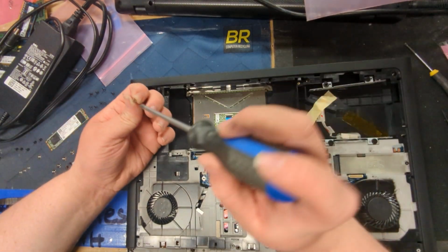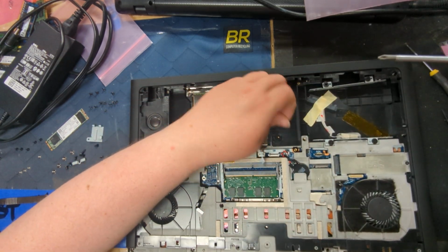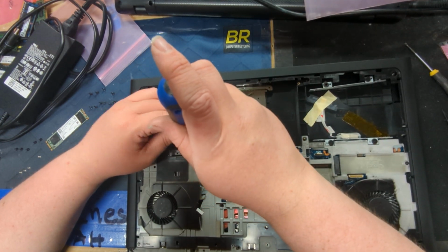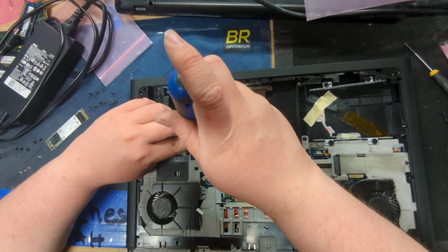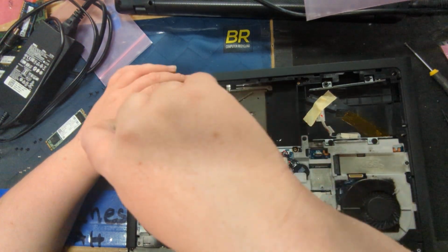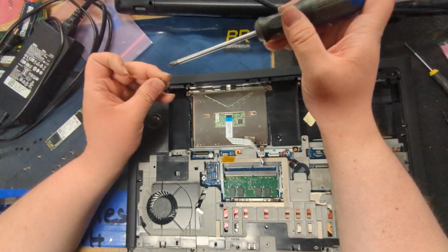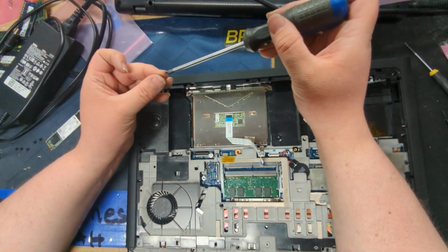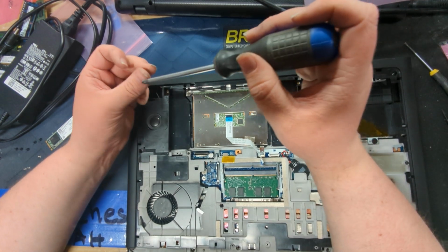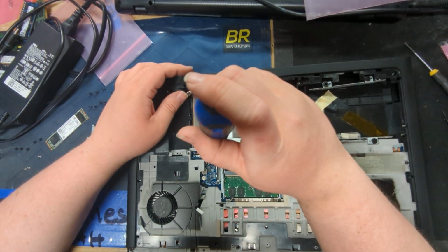Okay, so we want to remember that we have these flat screws that go here. Having a magnetic screwdriver does make a huge difference. It's not the end of the world if you don't, but it is really, really helpful. It's best if you have one that has some form of... You can actually get pretty good magnets. You want to put them kind of near the end, typically. Maybe I'll show how to pull one from a hard drive. Those are actually really good.